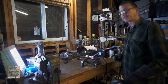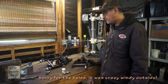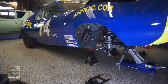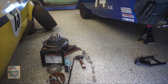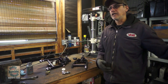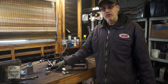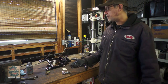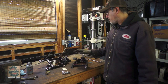Hopefully those tacks are going to hold it. The lower control arms are done. I had them in and out of the car several times. On the passenger side, I had to cut off the barrels, tack weld in the bungs, put in the rod ends, reassemble, lower the car, roll it back and forth, and check what camber I was at. I had to take it out, grind out the tack welds, and trim a little bit off the arm. I reassembled, put it back in, still wasn't happy, and had to take it out for a third trim. At that point I was pretty happy with it.